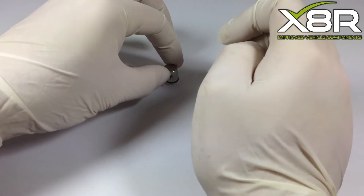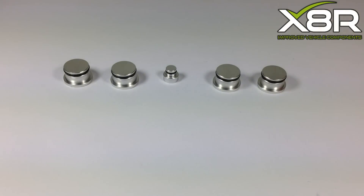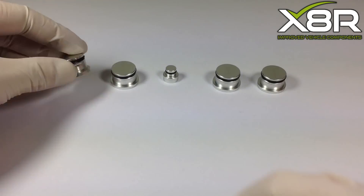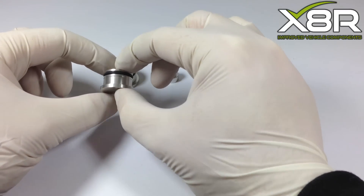There are two types of Pierberg manifold which are affected by this fault. They are very similar, but the blanking plates are slightly different. This video demonstrates how to install both types. They are primarily the same install — the only variation between them is the method of removing the old swirl flaps, but both methods are shown here for guidance.